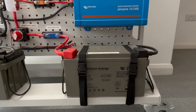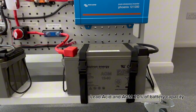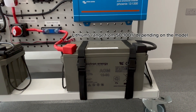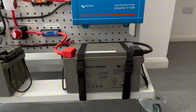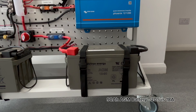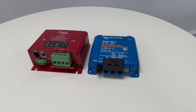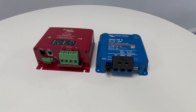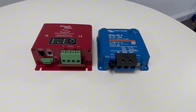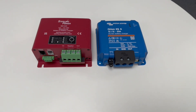Different battery types can handle different amounts of current from a charger. Typically, lead acid and AGM batteries can handle up to 20% of their overall capacity in a charge, and lithiums range from 50 to 100% depending on the model and brand of the battery. With this 90 amp hour battery, we would recommend not exceeding 18 amps from a charger. Some larger vehicles have a 24 volt starter battery but require a 12 volt leisure system, so you would require a 24 to 12 volt battery charger that can handle a 24 volt input and output a 12 volt feed to the leisure battery.